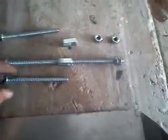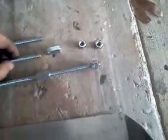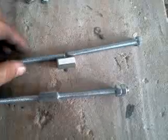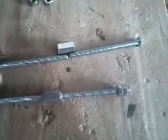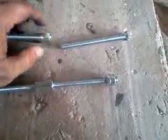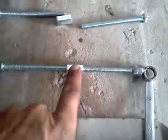So what you do is you join 2 bolts together with the coupling and tighten them down. Split the difference of both bolts inside of your coupling. Tighten it down on each end with a 13mm wrench. Tighten both ends down so the center will be tight.